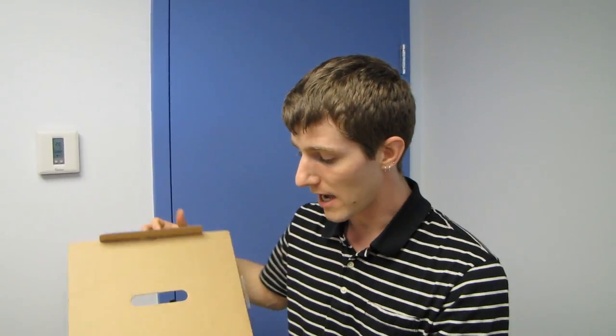This is the four terabyte SKU, which means it has two two-terabyte WD RE series drives inside. These are both 1.2 million hour mean time between failure drives, because this is meant as a server, not as a consumer product. And there is no room for failure of data in a server.